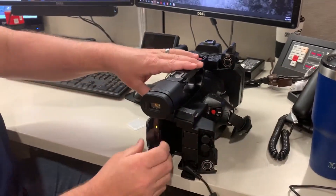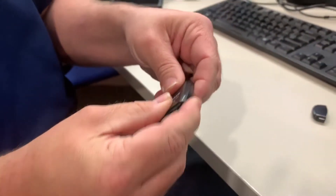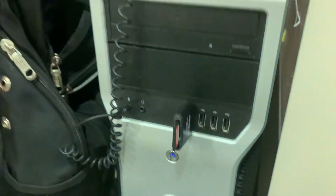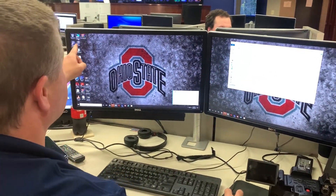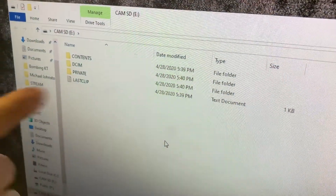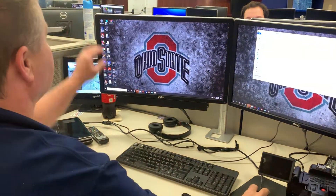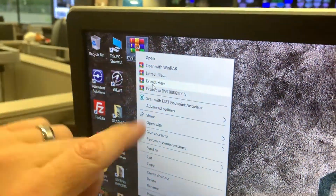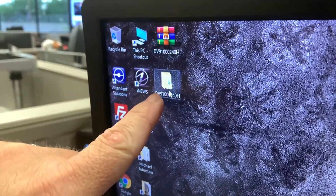Turn the camera off, then take your SD card and with a reader insert it into your computer because we're going to put the update on the SD card. On the desktop it should automatically open, or you can go into My Computer and open the SD card. You'll see it's formatted with contents — DCIM and private. This is it formatted to shoot, with nothing on it except those folders. Then go to the zip file and right-click to extract to the same file name, which will create a folder on the desktop with the same name.